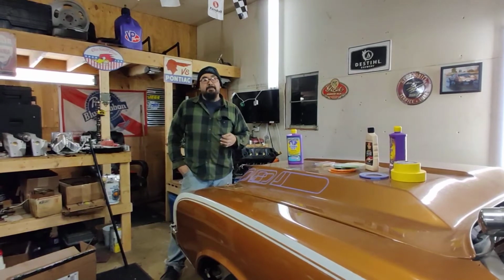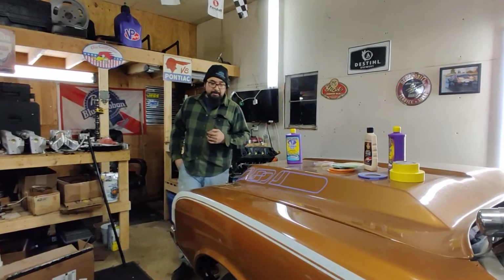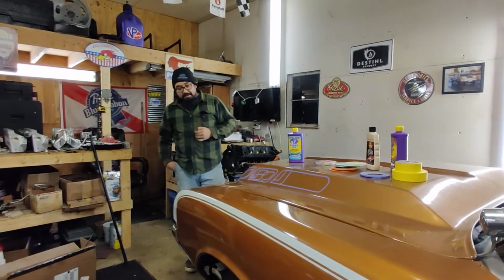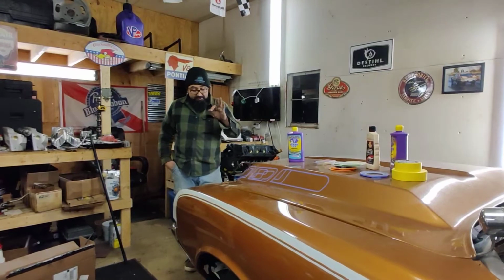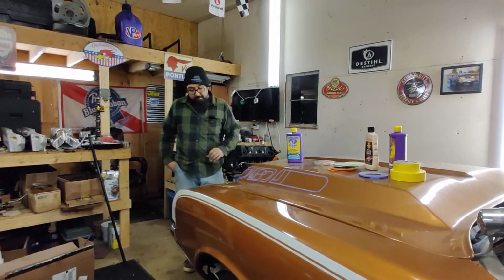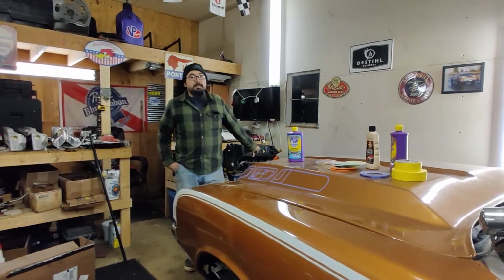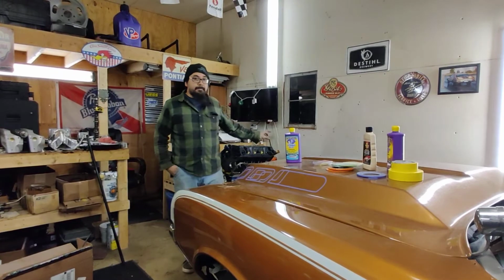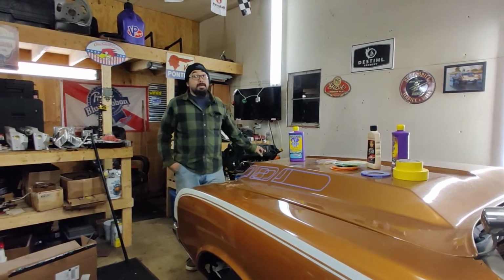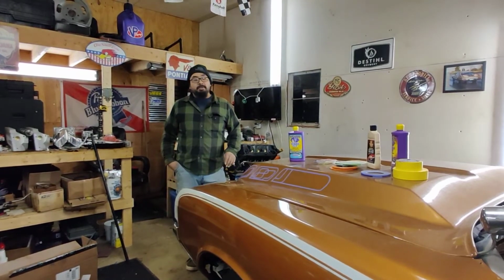And really, when you've got good friends in your corner, they really won't let you fail. So I've got to thank JJ for reaching out to me. I promise JJ, I'm not being hard-headed. I know what I've got to do with this. The bearings are like 90 bucks to add an extra thou of clearance, and it'll put us right there. So I'm just going to tell my buddy that's what needs to happen to make it right, because in my mind it's tight, it shouldn't be that tight.